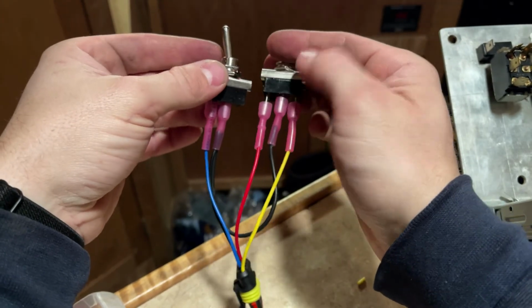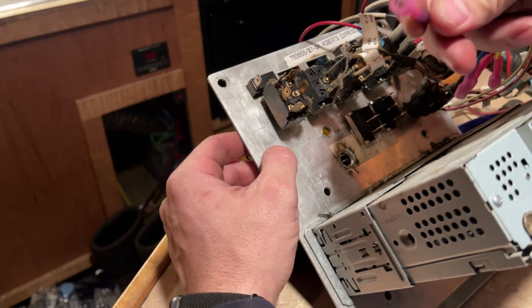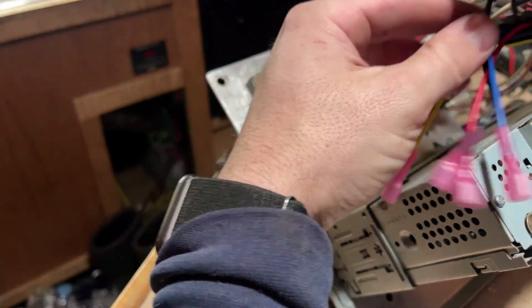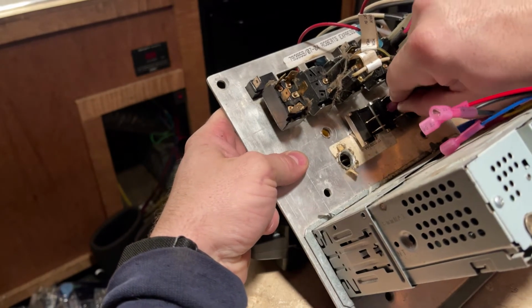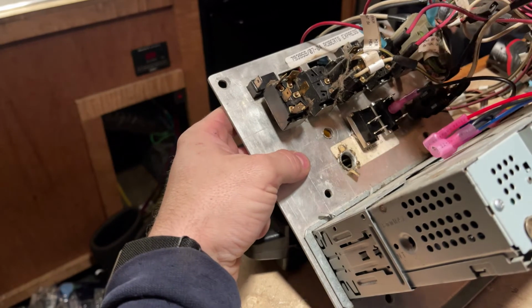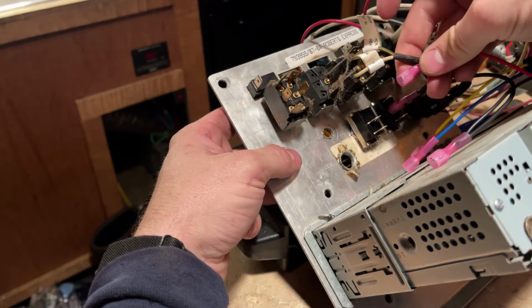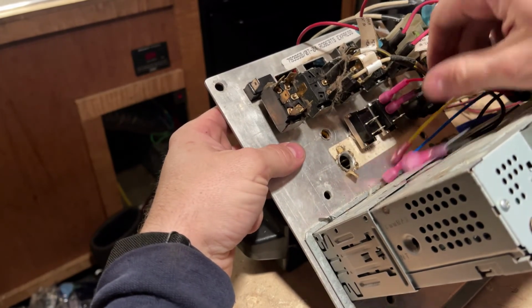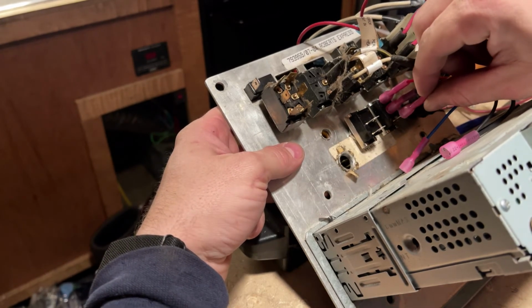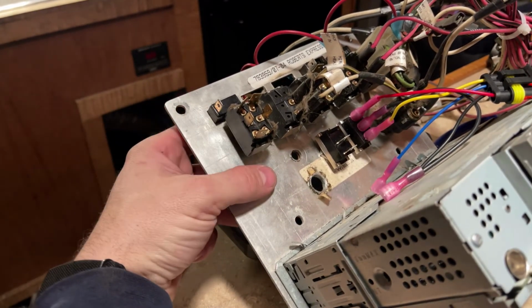Now, go ahead and unplug it from my example switches and I'll show it to you plugged into the back of the switch panel. Let's get our grounds. I'll start with the other guys so you can see better. So our ground for the far switch is the momentary switch, which is our cruise set resume. Okay. Set is plugged in, and then we'll finish with the resume on the bottom. Boom. 1, 2, 3. So that switch is set.